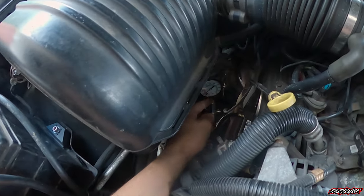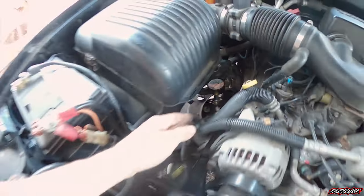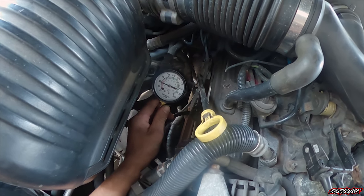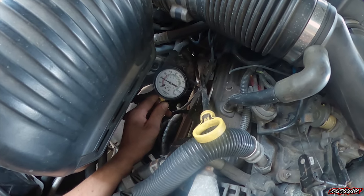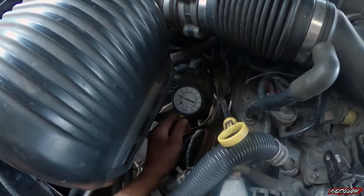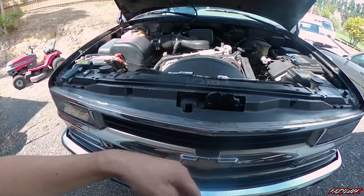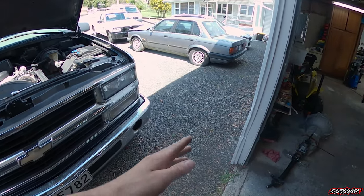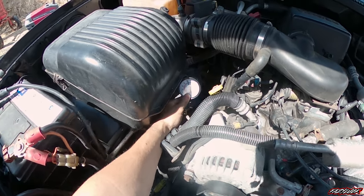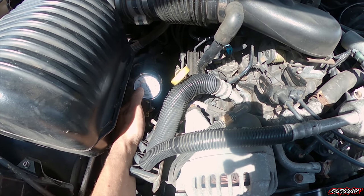Don't know how well you can see it down in here. Just fire it over for a second. Uh oh. So that's 60 PSI in the cylinder — it's not ideal, definitely want to be a bit more than that. So I just fired it back up again just to move it back out of the shed, and that same cylinder has come up to like 120 PSI — it was only on 60 before. And even 120 is not that great for a small block.